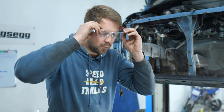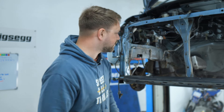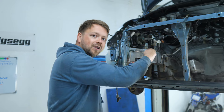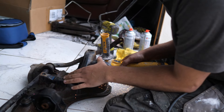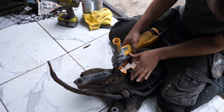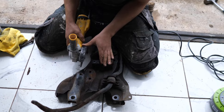One of the things that most people do when doing these chassis cuts is they'll only add the cut to the left-hand side. If you've watched Jack McNeil's Jazz build — brilliant series by the way, go check it out — one of the problems he realised he had is the water pump pulley was hitting on the left-hand side. So we thought we'd get ahead of the game and just cut it before we even put the engine in. One other cut required is in the front subframe — it makes you realise how much bigger the K20 is than the original engine that we need to take a chunk out of this. Out came the grinder and welder once again.